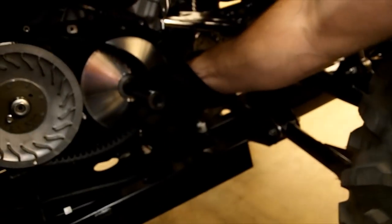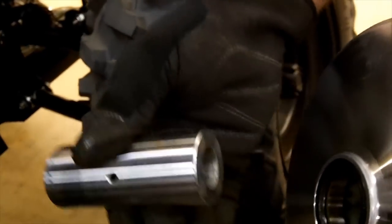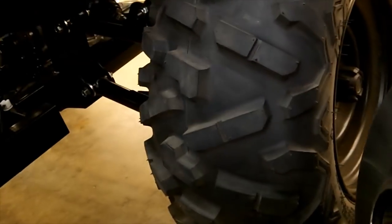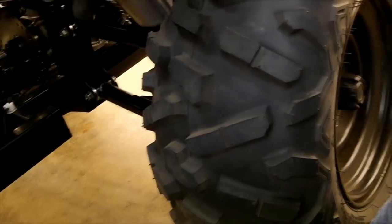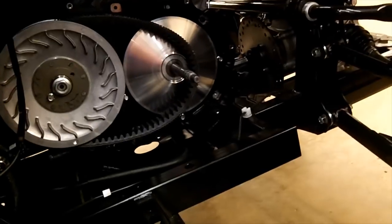Here's the back side of the clutch. This shaft sometimes will come off with the clutch, sometimes it stays on there. One thing to watch on these is sometimes they'll get a little bit of grease on the ends, so just make sure you don't get it on your belt. If you do, make sure you clean it up real good before you put everything back together.